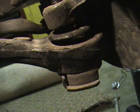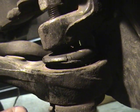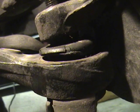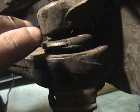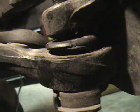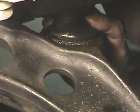You will know if your ball joints are bad from a combination of things. One, they may actually be cracked. If you notice here, it's split open — you do not want that. If your ball joints are split, you need to replace them. Also, if they're not split, you can just run your finger along them, and if you gather much grease on your finger, that shows that they're leaking, because the grease is supposed to be contained on the inside. If grease is leaking, it's only a matter of time before all of it escapes and they won't work anymore. The middle one up here has a less noticeable crack and is also leaking much grease — much accumulation around my finger here.